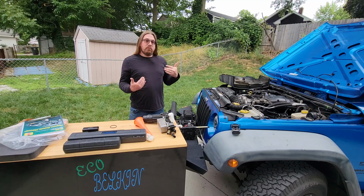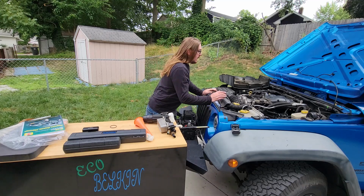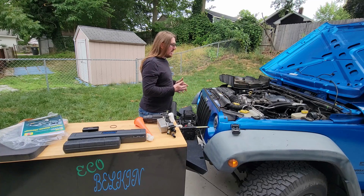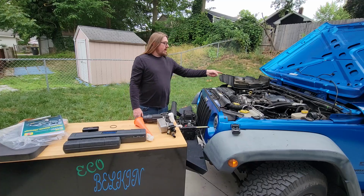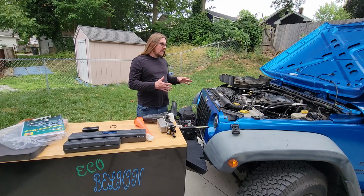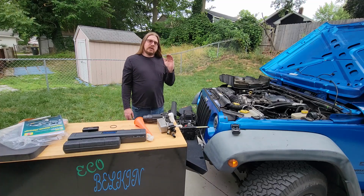I have to say, my own novice experience working on a Pentastar V6, it looks mildly infuriating, especially with this breather hose being in my way and I couldn't get it to really go anywhere. But outside of that, and the stupid brackets, so I tweaked the one bracket on the right hand side up and out of the way so I could get the upper intake off. But overall, it really wasn't that difficult of a job. It took me just over 4 hours start to finish.